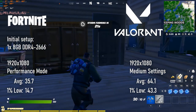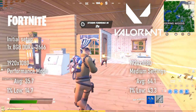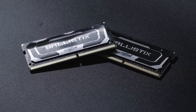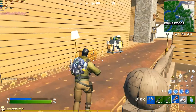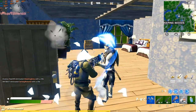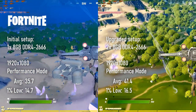Straight out of the box, just as with the HP machine, the Valorant and Fortnite benchmarks are lower than I'd like. As the RAM is being shared between the system and the GPU, that seems like a reasonable place to start upgrading for better performance. Swapping the single stick of 2666 for a pair of 3200s, the locked down Lenovo BIOS prevents me from changing the frequency of the RAM to its fullest, meaning we're stuck at 2666.